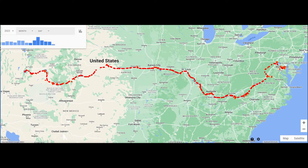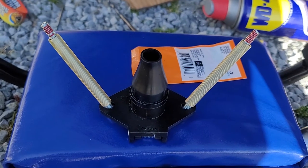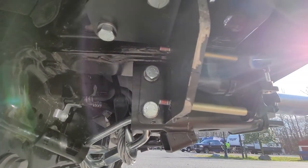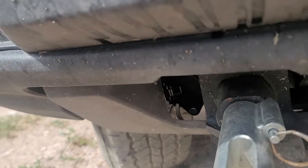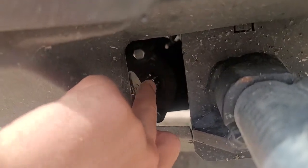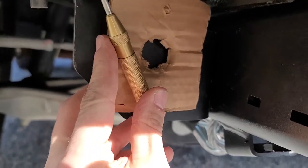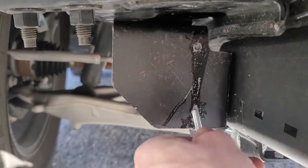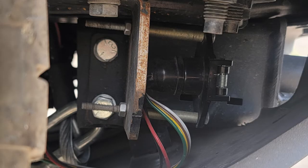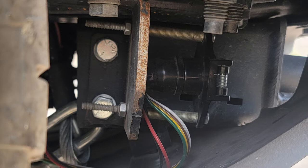Here's the plan: I took these 3-inch nipples from Home Depot, ordinarily used to support ceiling lamps, and inserted a pair of what I believe to be 3.5-inch, 3/8-inch diameter hex bolts through them, as well as the connector. The idea is that this gives the rather long connector enough offset from the adapter plate so the wires have enough space, and also so the connector is reachable through the bumper. I took the 6-pin connector and made a cardboard template to accurately gauge where to drill the holes in the mounting bracket. I lined up my template, used my center punch to mark where to drill, made two 3/8-inch holes, and you can see where I'm going with this. Once confident you'll have enough slack in both the 16-gauge wires and the 4-conductor cable, you can cut, strip, then tin the tips of the wires.